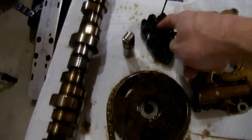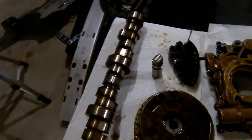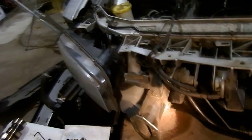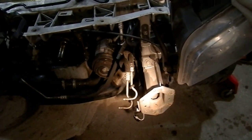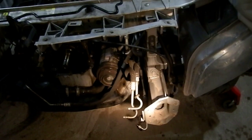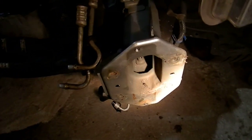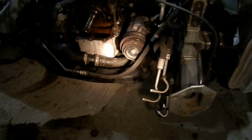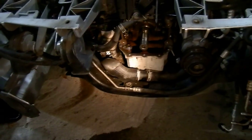So this is getting replaced: timing chain guide, camshaft, and a bunch of lifters. I actually left the engine in the car — the entire front end came off, bumper assembly and all. It is a lot of work but it's a lot easier than pulling the engine. The bumper cover comes off very easily. The bumper bar is tack welded on — after you take the four bolts off you have to drill a top and a bottom one out. The AC has to be discharged, then pull the radiator out — it drops out the bottom with the condenser and lines.